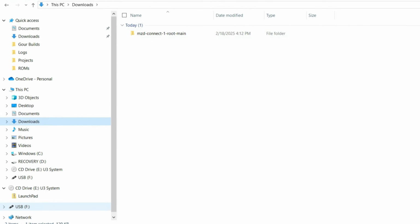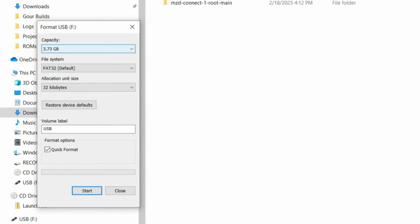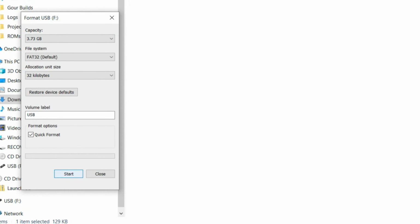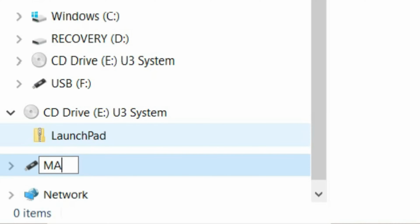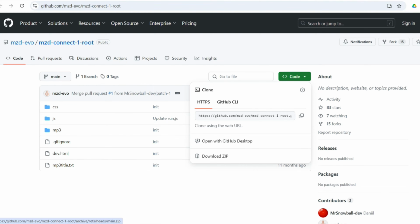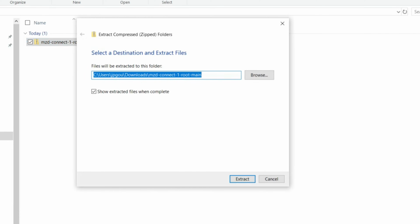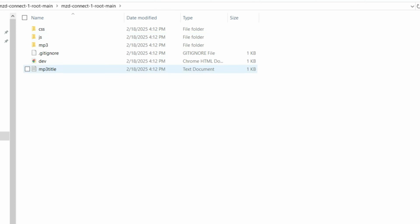All right, so for the Mazda Tweak, the first thing I do is format a blank USB. I make sure that it's FAT32 format. Renaming the USB to something the system will consider familiar is also supposed to help, so I named mine Mazda. Then I download the MP3 file and extract it. Don't worry, I'll leave links for all the websites in the description. With the file extracted, I copy its content into the blank USB.